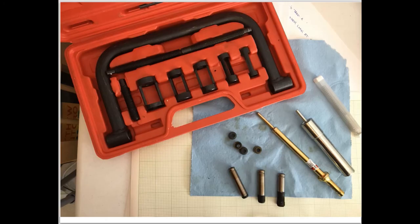Here are the tools that I used. The valve guide press is a Snap-on, part number PHG97A. The valve seal press is Subaru tool number 4988-57100. The reamer is Subaru tool number 499-76-7400. And the valve spring compressor I got off Amazon — it's a no-name, but it was less than 20 bucks and it worked really well. I'll post a link in the comment section below.